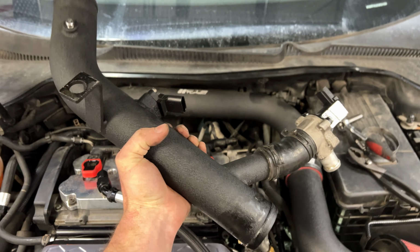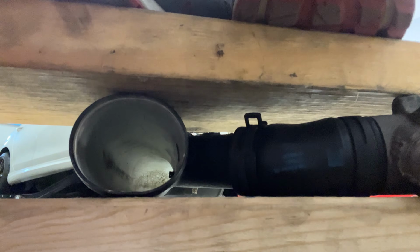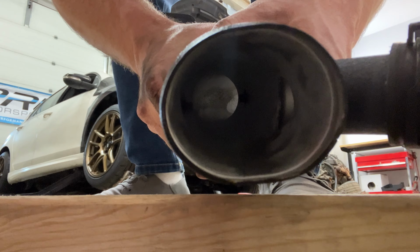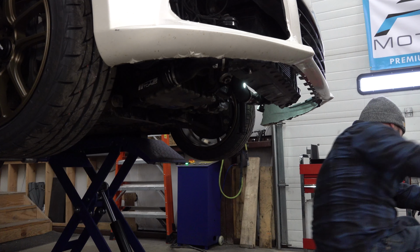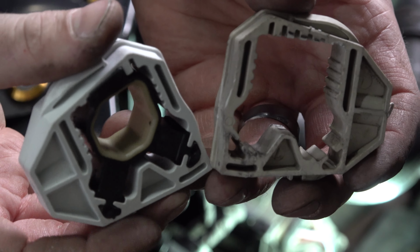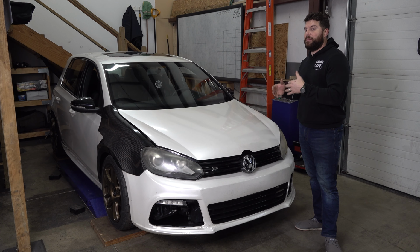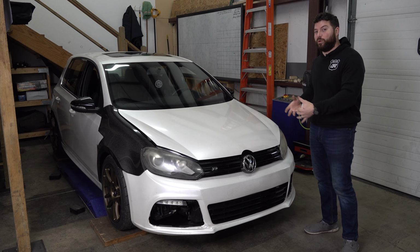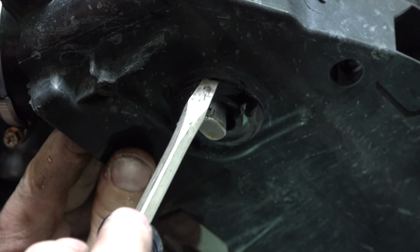Then I had that problem where the throttle pipe coming up the front was really wedged against the radiator fan. So I massaged that and got it wedged into an oval shape, really narrowed it down. And between that and getting this up on the lift and sneaking my intercooler mounts in, that helped bring the whole intercooler radiator assembly forward and got it away from that charge pipe. And now we have room between the fans and the charge pipe. So instead of pulling the whole core support out and getting that stack separate, I just finagled them in there.